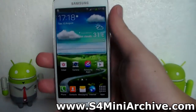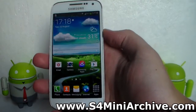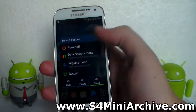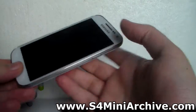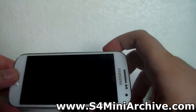Now that we have flashed the custom kernel and the CWM recovery, what awaits us is the rooting process. So what you need to do after this is power off your phone again, and this time hold the home button, the power, and the volume up — not volume down, but volume up. This will take us to recovery mode.